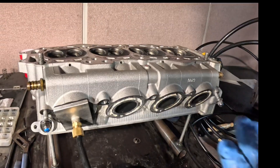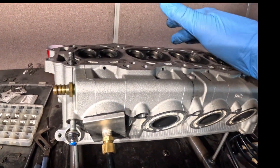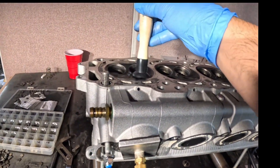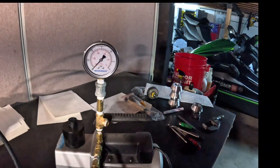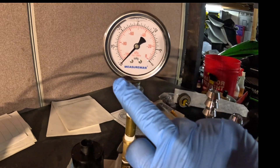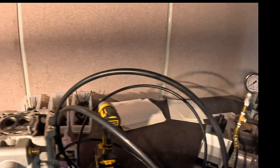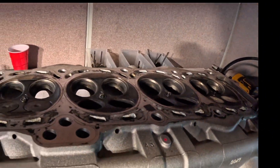You want a kick-ass cylinder head — you want it done right. So you want to cut the valves and you want to cut the seats. And if you have to, lap them just a little bit to get your 30 inches of mercury. You can get 25, 26, 27, 28 — but you want 30. That's what you want, all around. And that's pretty much pure vacuum.